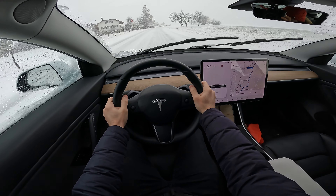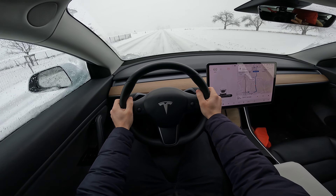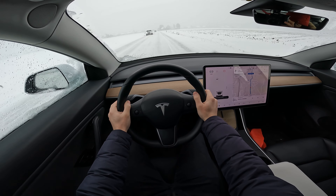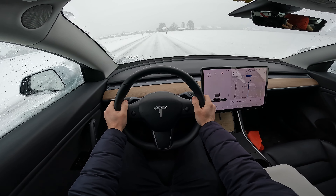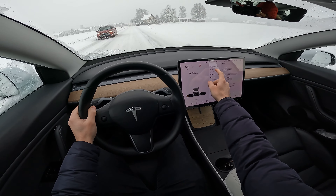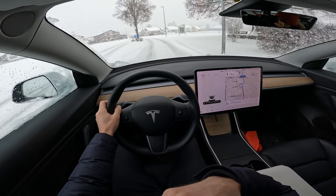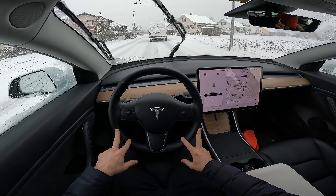Enough with that — let's enjoy the ride a little bit. It's beautiful, really beautiful. It's doing just fine. Maybe a little bit aggressive at high speed — I see that when you have high speed, it's better to leave the regenerative brake on low. Because when you have higher speed and the car tries to regenerate so aggressively, then the wheels will be blocked and you will be kind of slippery. The guy who commented last time was right.